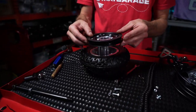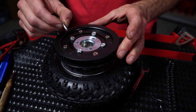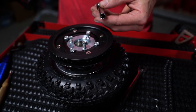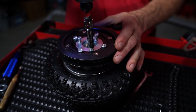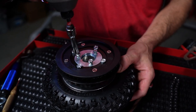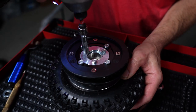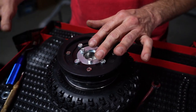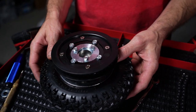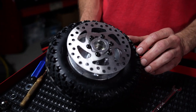Reinstall the gear the same way it was removed. Grab the three 8mm bolts with their existing lock washers and hand-thread them into the wheel. Then use an 8mm socket — snug them up so threads are started, get everything nice and snug, then finish tightening all three bolts. Don't over-torque these three bolts — customers have snapped them, requiring a new wheel half or bolt extraction, so just be careful.